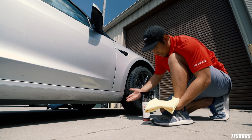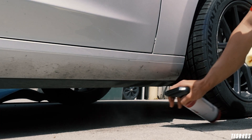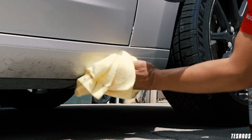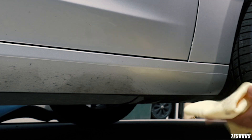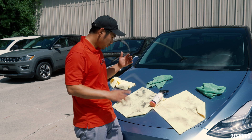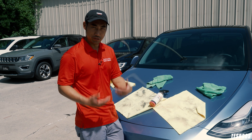For this one we're going to try to test this super dirty rocker area. It has a lot of different types of dirt and there's also some tar over here, which can be quite difficult. Same process — saturate the area and try to hit that front part. You can see that it definitely cleaned it, but there's still a lot of stuff there. Even after a second pass it's noticeably cleaner, but I wouldn't say this would be the best for removing tar or anything super tough. Hopefully that was helpful in figuring out what waterless is perfect for — it was highly effective in many areas but also had its limitations. This is not an end-all solution, but as mentioned, there are great uses for waterless wash.